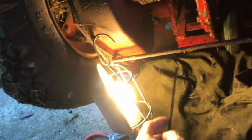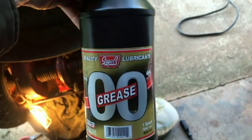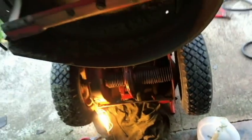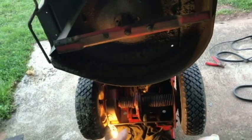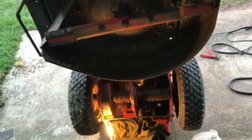Awesome, that'll be it. I'm going to do the differential off camera. If you wonder how much you've got, just use a dipstick — something like this zip tie works out pretty well. Some Snappers are going to have two plugs; I only have one up here. Thank you for watching the video. That was just showing you double aught or double zero grease to be used in these Snapper riding mowers — the transmission or differential and the gear case as well. Thanks again, have a nice day, take care.